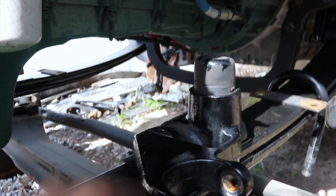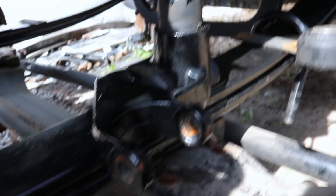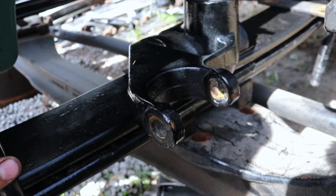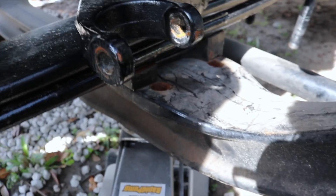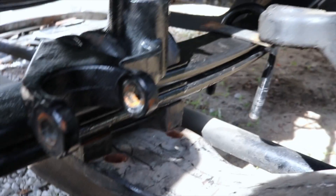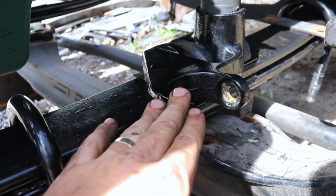Next step — I need to adjust this front axle so it fits exactly into the groove of this plate. The plate goes straight on top, and then the new U-bolts go straight inside right here. Then I have the sway bar bushings that go inside here — this bolts straight onto the bottom like this, and on the other side there's a bracket that goes on the bottom, and that's it. We're going to fast forward, put these on, and connect everything correctly.